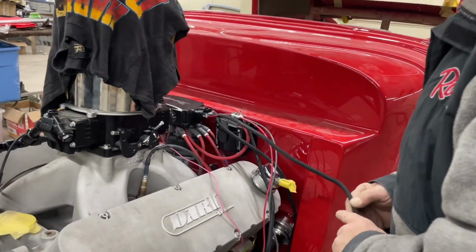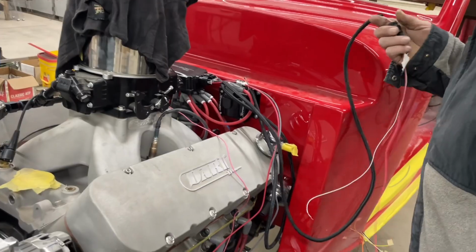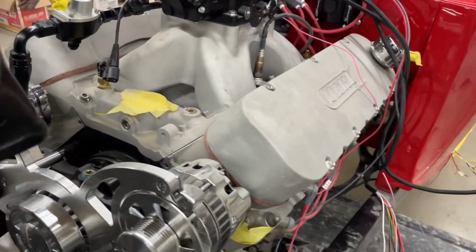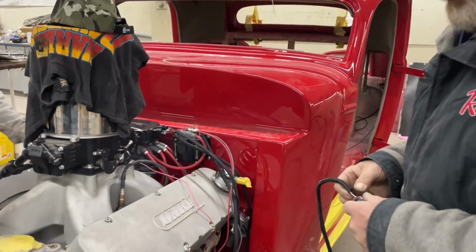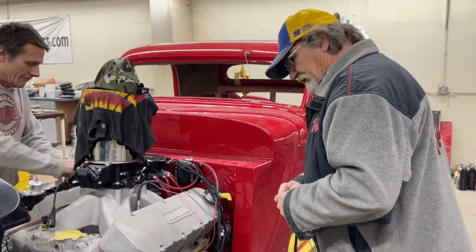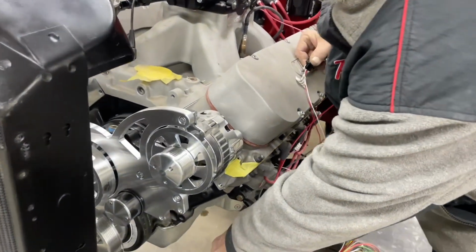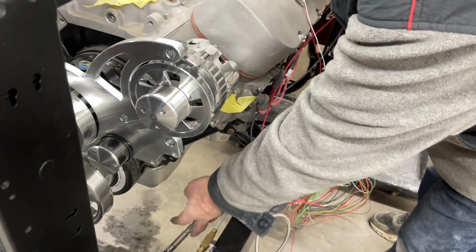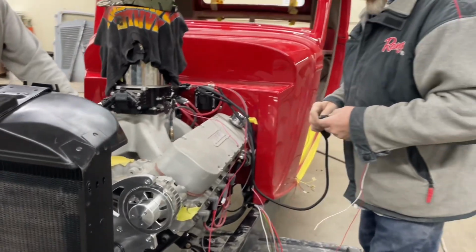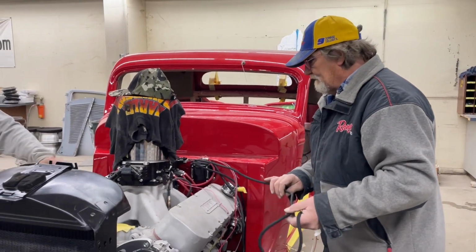All right, and surely we've already fitted the steering column. We're going to have to have a carrier. I got a couple already, so I'll get you to make a mount. And I need 3 U joints and one that'll fit this rack and pinion. The ones we got are too big. It won't fit the splines on this. That's like a Mustang 2 rack. Yep. All right, so then we'll have steering done.